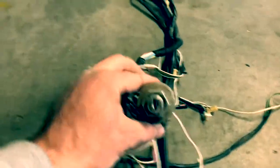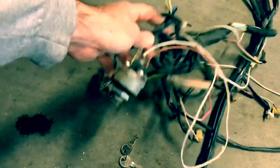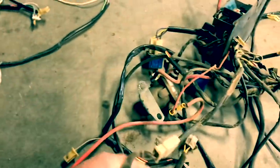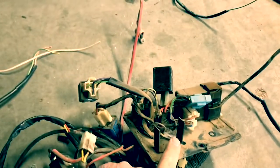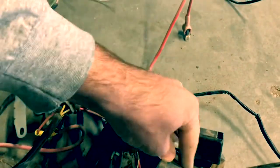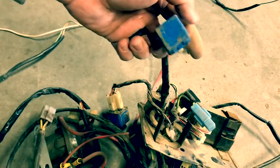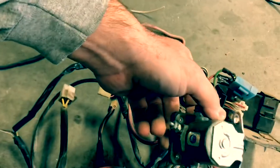Kind of my plan is I'll go back, use the original ignition, keep basically those wires that are on here. Those will go back to the rectifier regulator. I plan to keep that so I can keep the charging system going. Some of these wires that go up in here, I'm assuming this is just a fuse — keep that. Not 100% sure what all this is. This is probably something to do with ignition. I'll have to go through all these little relays. Some of this stuff is probably for turn signals, lights, that type of stuff. Here's the starter solenoid — that'll stay.